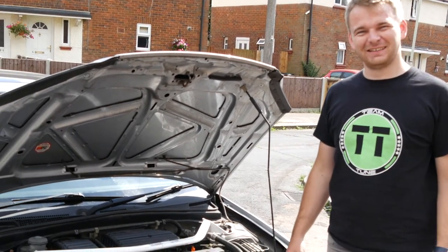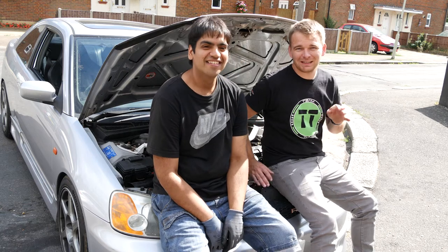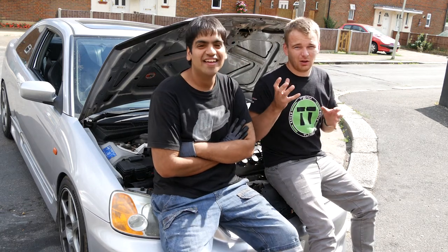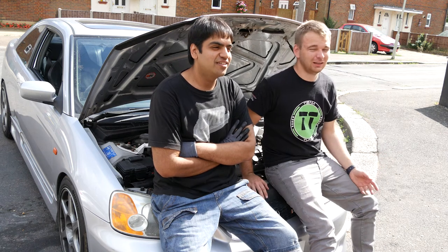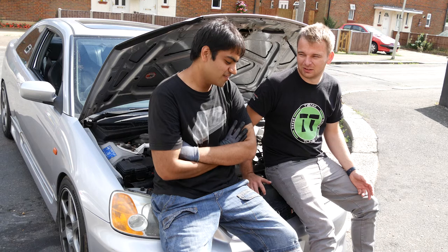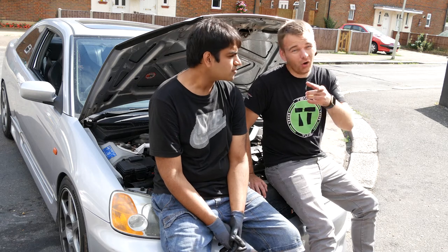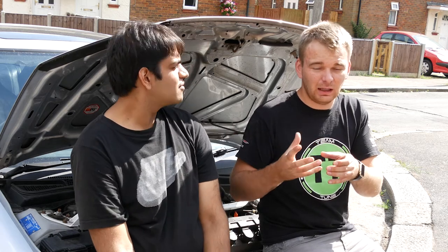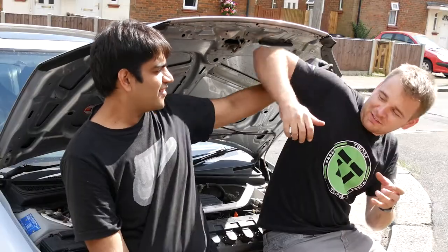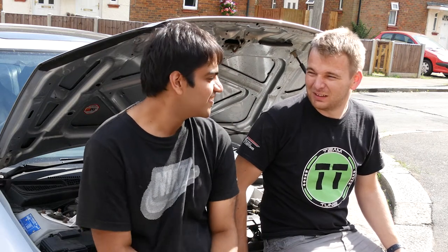You've got to look good, you know. So what did we achieve today? We learned that the Honda oil filter is in such an awkward position, it should not be allowed - it should get a relocation. You might do that on the new engine. The other thing - you cannot pre-fill the new oil filter with oil again because it's horizontal. The idea is you soak the new filter with oil before attaching it, but because his Honda is horizontal, you can't do that. Your car sucks.